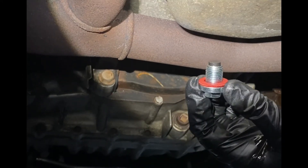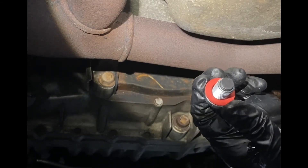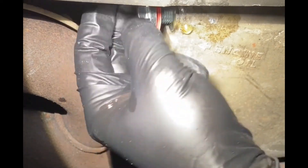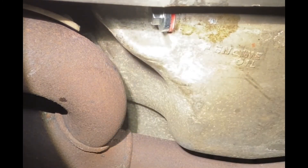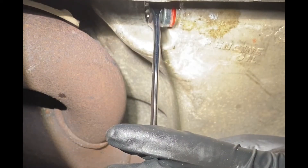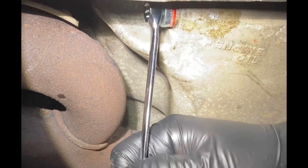We're going to install the new drain plug with the magnetic tip. I'm installing this magnetic drain plug because I want to find out if this engine is shaving off any metal — hopefully not, but I'll check in about 5,000 kilometers. Take your time installing this, do not rush. I believe this takes a 13mm socket. Same as the oil filter — do not over-tighten. I'll torque it with just a quarter turn, maybe just a little more.